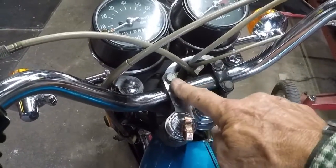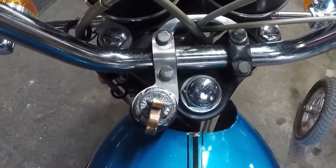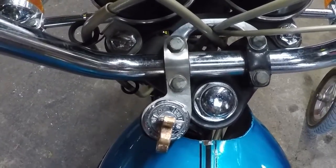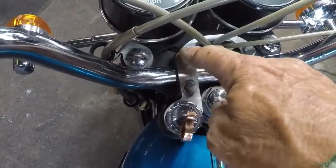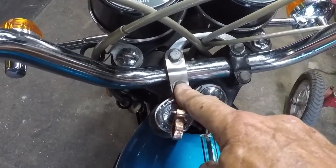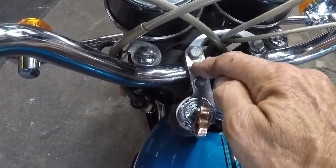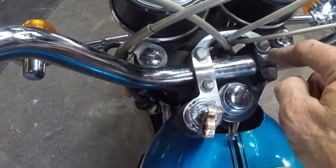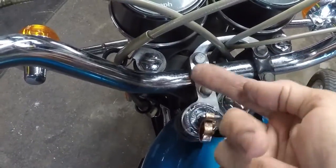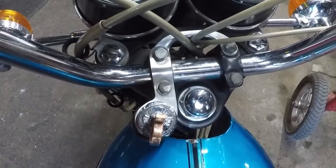But just made it out of stainless, cut it and contoured it to try to make it look half decent. I don't think it looks too bad. And I even remembered to space the holes out farther than what they should be, because I knew when I clamped these down, you can see this bow here, it would clamp down and has a little bulbous area there, would push that up and not stress the bolts going into the aluminum.